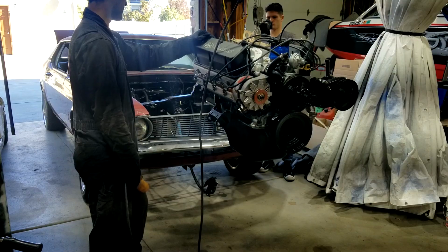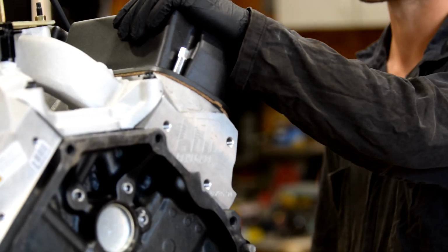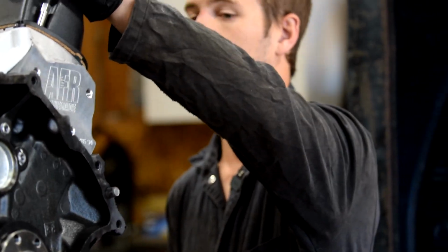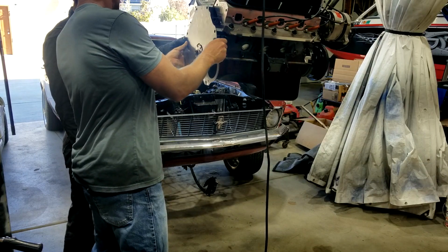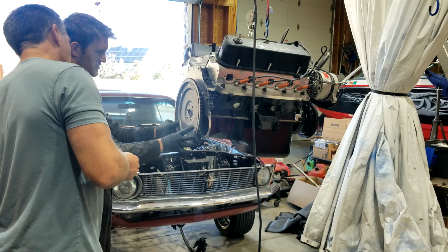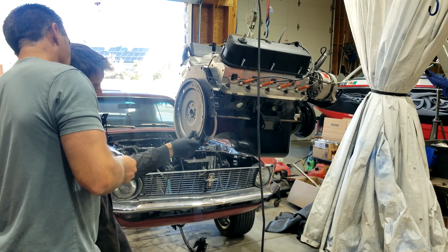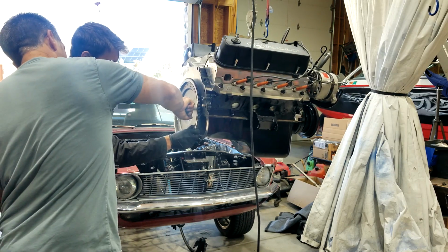The project turned out really, really well. I was quite surprised at how cleanly everything went. In terms of project notes, I would mention three things that are not well illustrated in the video. The flywheel is weighted and therefore needs to be installed correctly. I was looking for a pin or a dowel or something. It turns out the holes are not equally spaced, so you can only put the flywheel on in one direction. So that actually worked out pretty well.